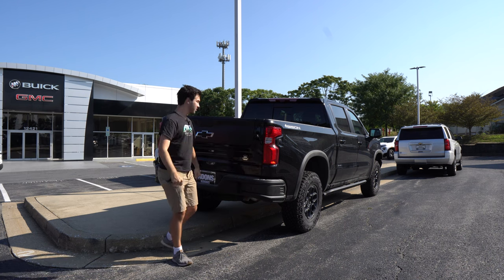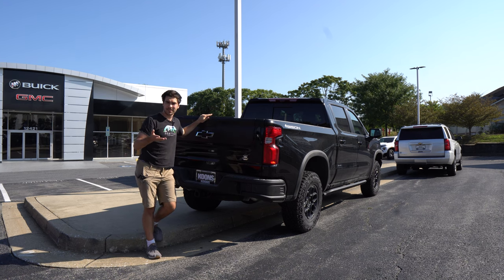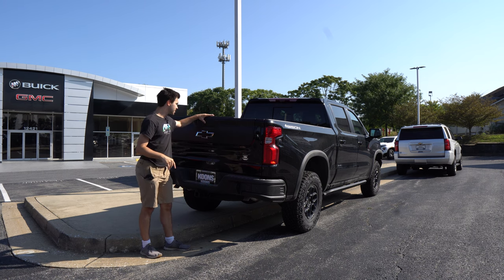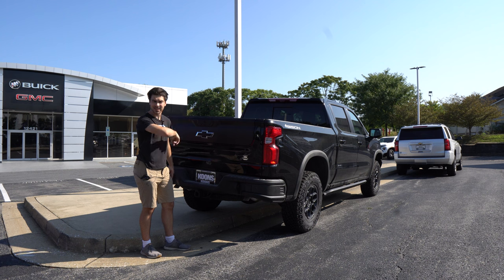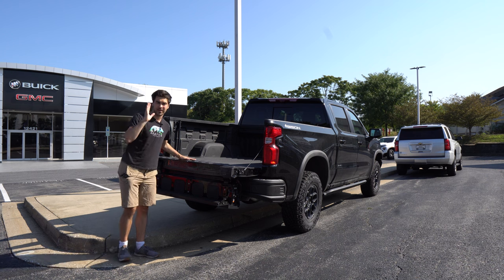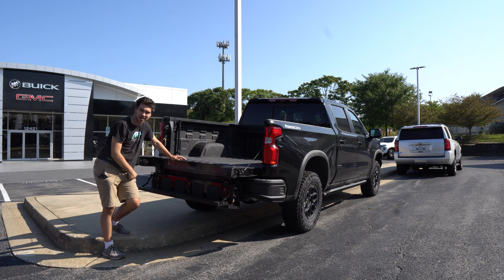Here at the rear of the Silverado, we have our Multi-Pro tailgate — a $445 option but a pretty fun one. You have a little baby tailgate and then the big tailgate. General Motors heard from their customers that they didn't like the baby tailgate coming down and hitting their trailering connections. So GM said: if you press and hold the top button for three seconds, it will disable the tiny tailgate so you won't accidentally release it and hit your trailering connections. You drop the main tailgate first, then reach under and drop the baby tailgate — you can pull this out and it becomes a step. You can also take out the little panels and put in a speaker, which is about a $900 accessory for the ultimate tailgating machine.